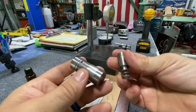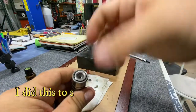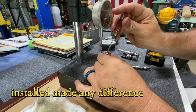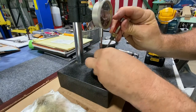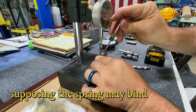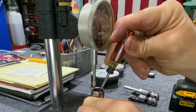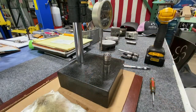Since I've got this all cleaned out, I'm going to put the plunger cap back on and put it on the comparator stand and push it down to see how much travel I have. I started right here, and I've got 150 thousandths of travel, so 75 thousandths will put me right in dead center.